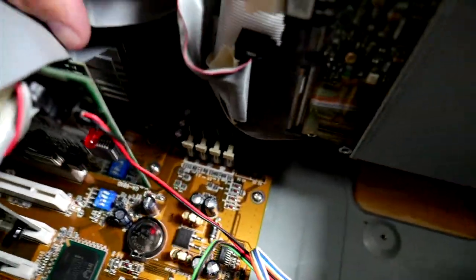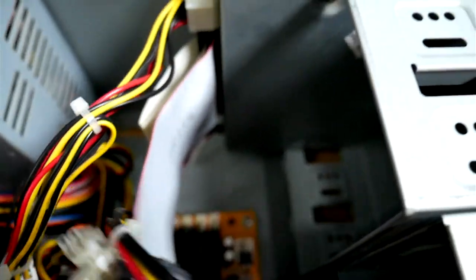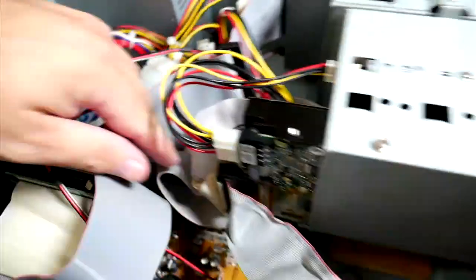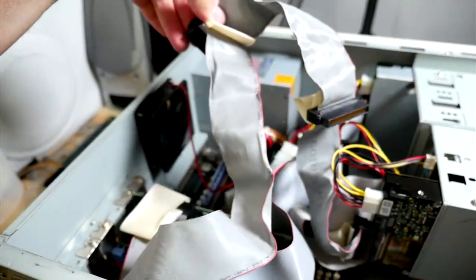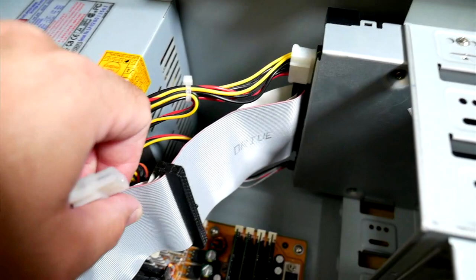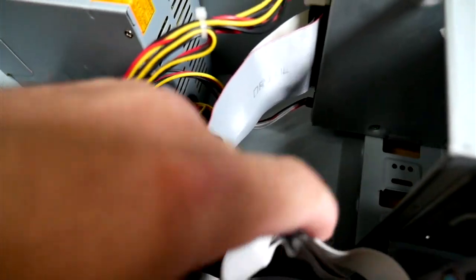It's got four memory sticks in it — good old SDRAM DIMMs. You remember when they went from SIMMs to DIMMs? I do, because I'm old like that. These SCSI cables need to get out of my way. SCSI uses a daisy-chaining setup — that's why the one cable for the hard drive has three connectors. This is 68-pin SCSI-2 here, and 50-pin here. You see a lot more SCSI on Macs, but a lot of PCs used IDE.